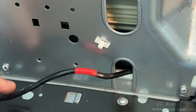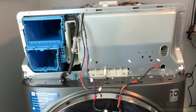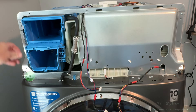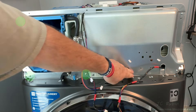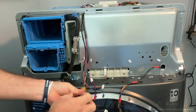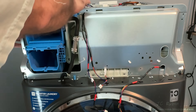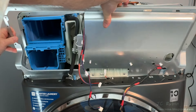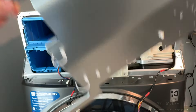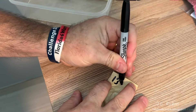I cut the other cable tie from this front panel — notice the red tape on the cable harnesses, which will make it easier to reassemble later. Cables and hose now disconnected, we can remove this cover by removing these six screws. The cover is then lifted off, negotiating the cables and hoses through so nothing gets caught. These will be screws 13 through 18.